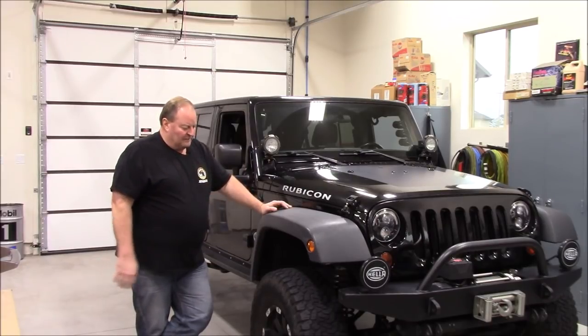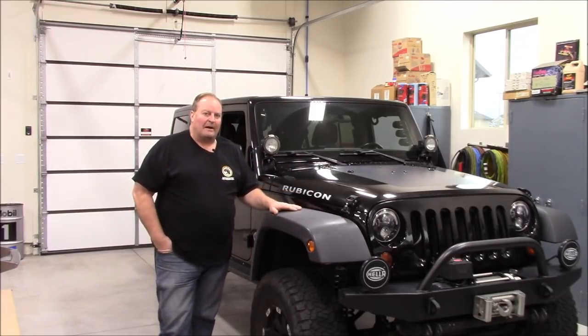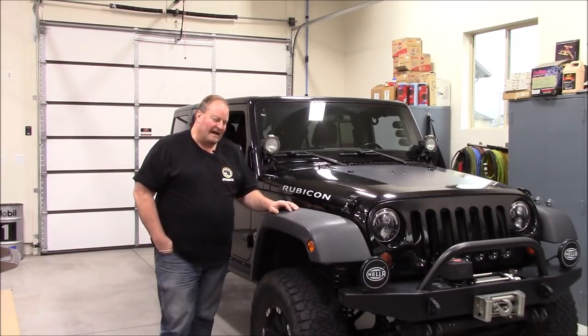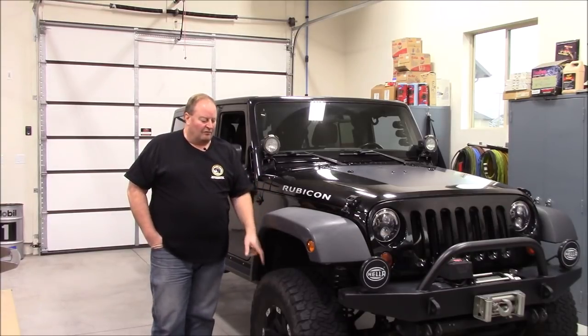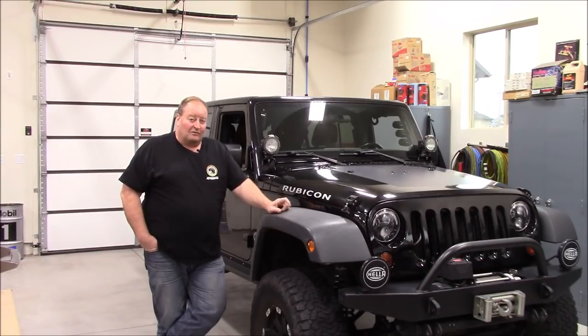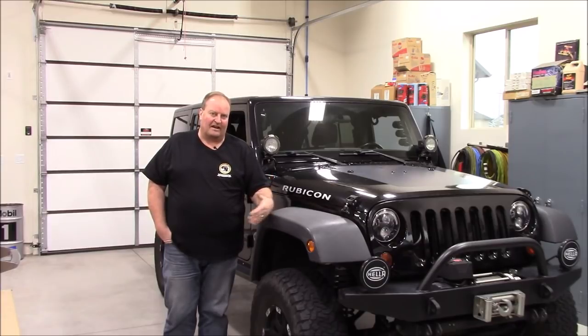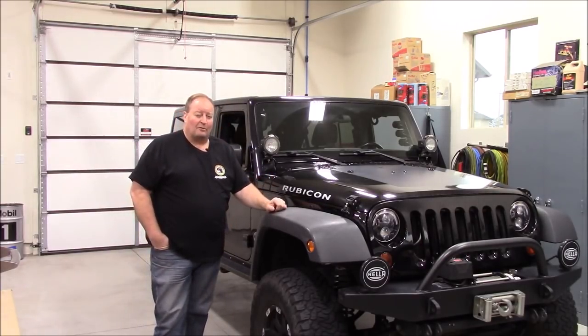When I do my gear swap, I'm going to switch over and put 4.56s in — I've got 5.38 gears in it now. But she's getting a new powertrain. The 3.8 has never impressed me; I've just put up with it. That's one of the reasons why I haven't gone anything bigger than 35s. I know a lot of people run 37s with this engine and seem fine with it, but personally I'm barely okay with the 35s, and I've got plenty of lift to run 37s.